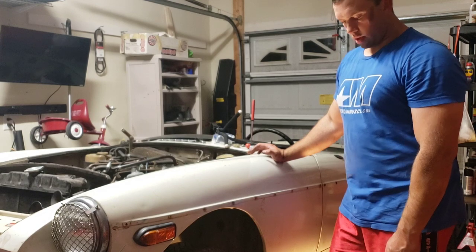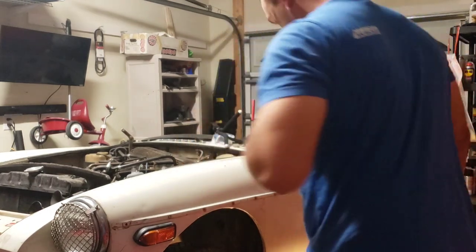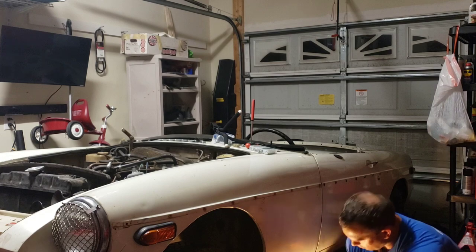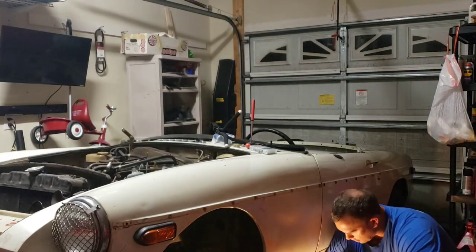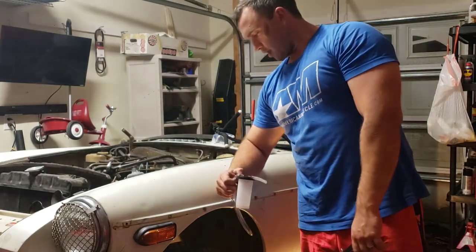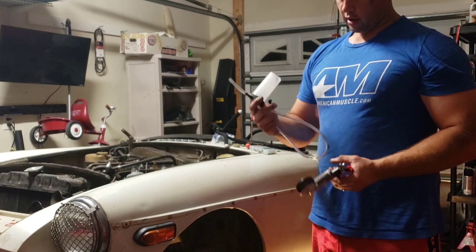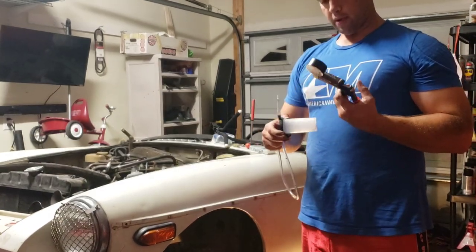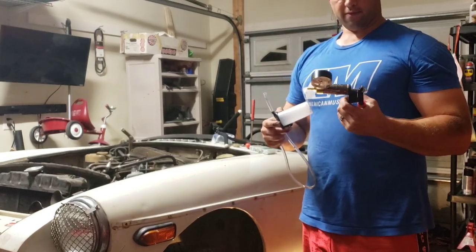Please like and subscribe. So here's what we did essentially: the first test was I had my wife step on the pedal — that was a big mistake because my wife is teeny. I had to put my full force into it at 230 pounds. Then I used the vacuum bleeder kit from Harbor Freight. A lot of bad reviews, but everybody was saying it was bad if you let air into the gun. I didn't do that, and it worked great, just fine for me. It was 20 bucks and I was able to get the clutch bled.